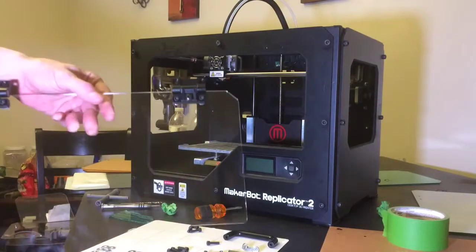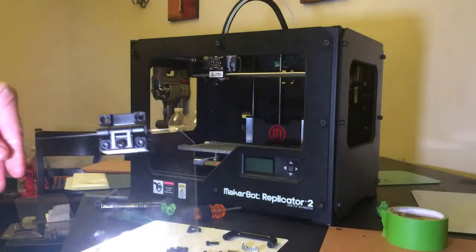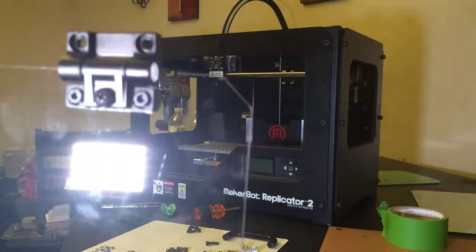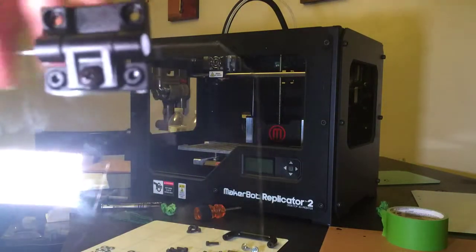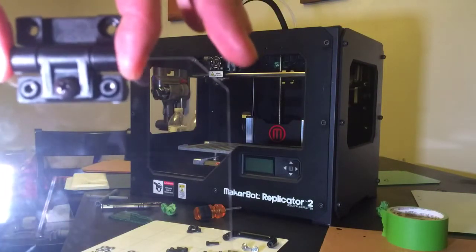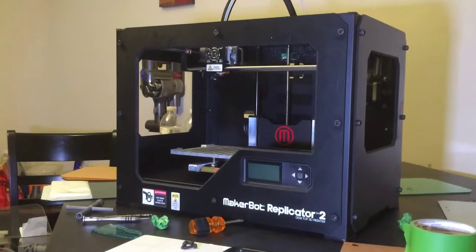So now I have the four hinges pre-installed on the door here. You can barely see, with the Phillips head screw facing the bottom. And in pre-tightening this, or hand-tightening this, we want to make sure it moves left and right, because we're going to need that little bit of play there while we adjust the door.